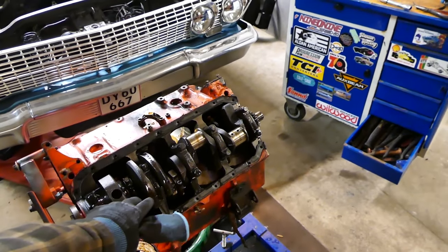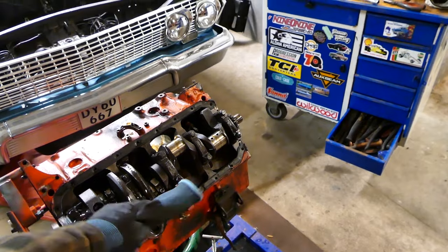So I just started a time lapse of pulling out the pistons, right? But I realized that I don't really want to do a time lapse because I pulled 3 pistons so far and I'm on the 4th one now. And every time the piston comes out of the cylinder, the top piston ring has cracked in exactly the same place on all 4 pistons so far and perfectly falls off the piston and down on the ground. We're going to catch the next 4 pistons when I take those out if they do exactly the same.